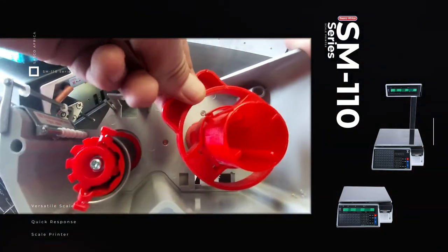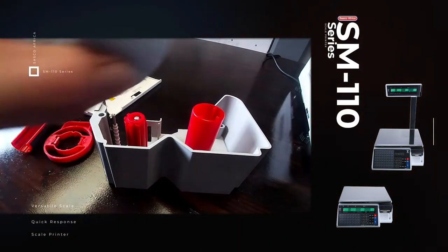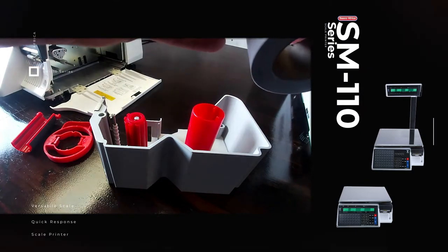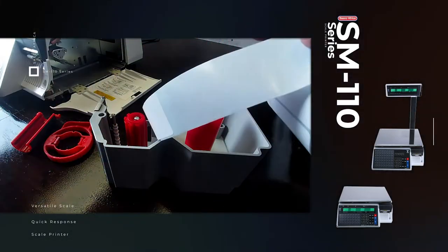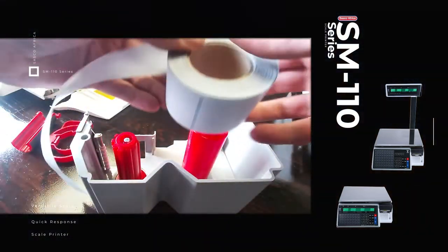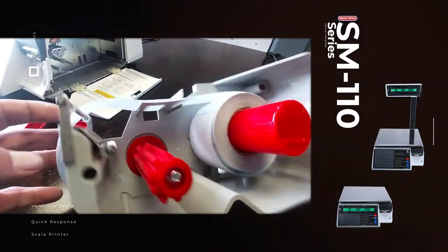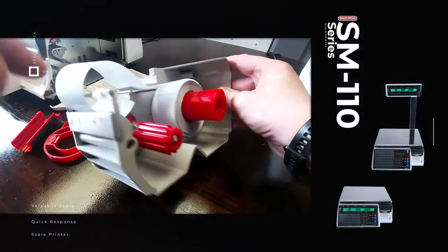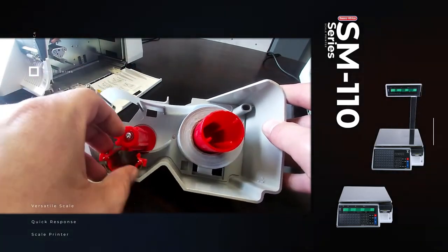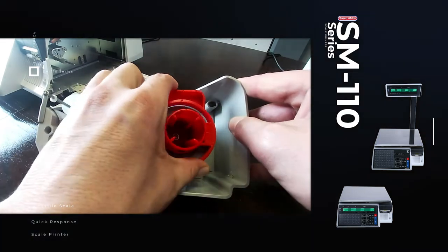This is what your cassette looks like on the inside. You will have a stop — just turn it to the side, pull it off, and remove the label brake as well. To prep your roll of labels, make sure there's a little piece rolled off. Put it over and in between the two metal bars and the plastic guide, then roll it through that gap and bring it around to your take-up reel. Clip one side on and put the other in the middle with the guides — your labels are now set.